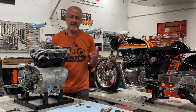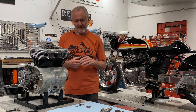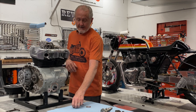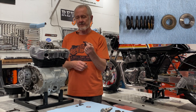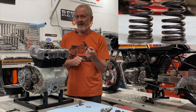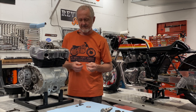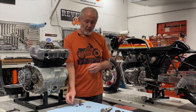What's involved in installing an S&S camshaft? We're not going to do a detailed how-to video because that's already been done, and frankly this is not something you want to do in your brother-in-law's shed — you want someone very adept at engine building involved. The reason is that the S&S cam comes with a valve spring shim that is required to increase the spring pressure on the valve and rocker arm, making it more closely follow the cam at higher speeds to prevent valve float. You definitely don't want to put in an S&S cam without one of these. Installing these requires removal of the valve springs using a valve spring compressor.